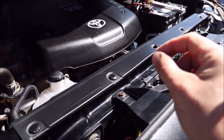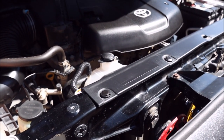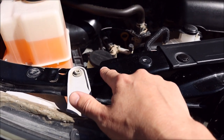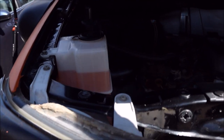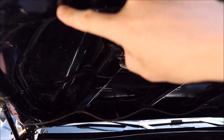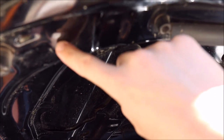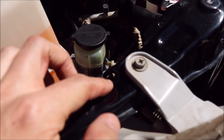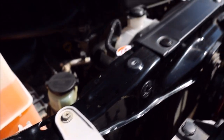As far as placement of the strikes on the radiator support — that large front piece of metal — a lot of cars have holes already in there that you can use, but not so much on the Tacoma. My buddy Randy put it on the inside of the headlight support, but he said if he could do it over he probably wouldn't, because it lines up on a rounded area. He said if he could redo it, he'd put it on the other side of the headlight support where it's relatively flat. That is what I did — I already drilled these holes yesterday. You can see one right there, same on the other side, with paint on them. So the first part is figuring out where you want the strikes.